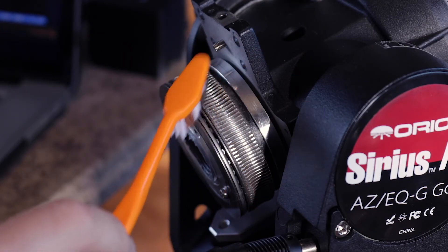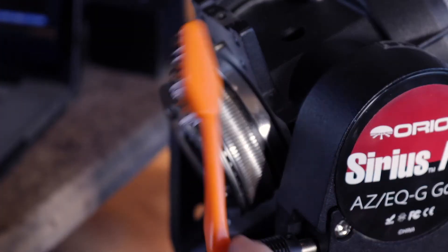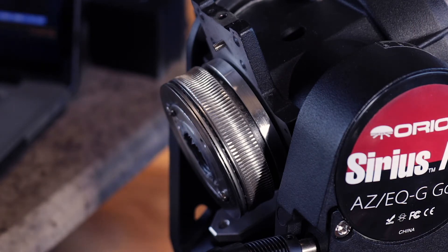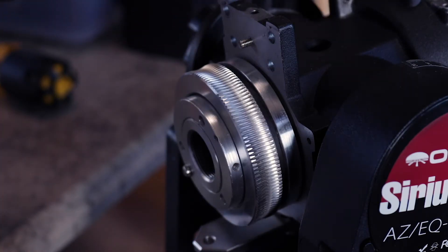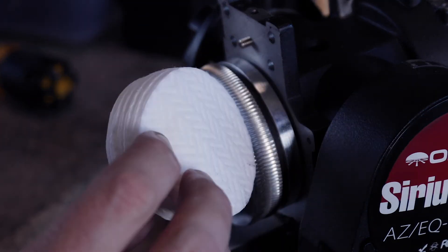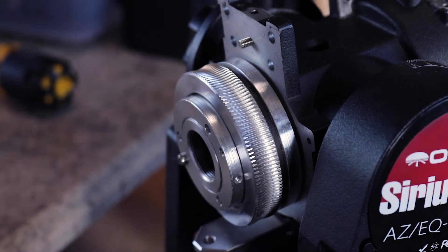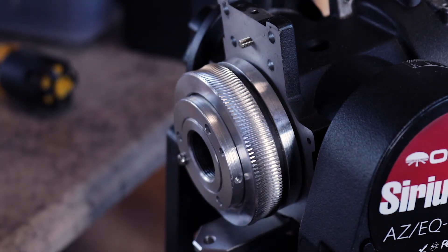Now what we want to do is get everything out of these teeth as much as possible. It's a combination of wiping with cotton swabs or paper towels and then working at the teeth some more - that'll smear it all over the place, and then you wipe it again. Keep going back and forth like that until it's all cleaned out. The ring is now all nice and clean and I've taken the clutches off to clean it easier. Avoid cotton swabs - they leave too much residue behind. Try to get something more lint-free; I ended up with regular Bounty paper towels.